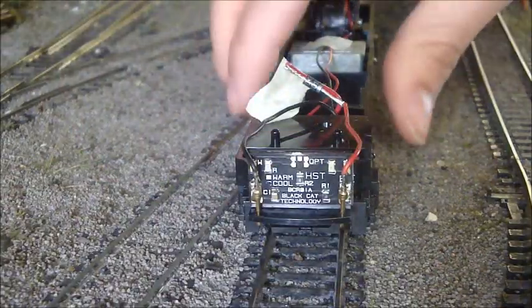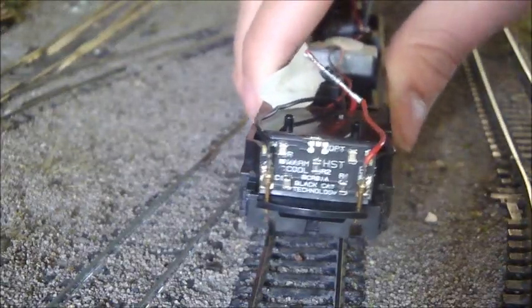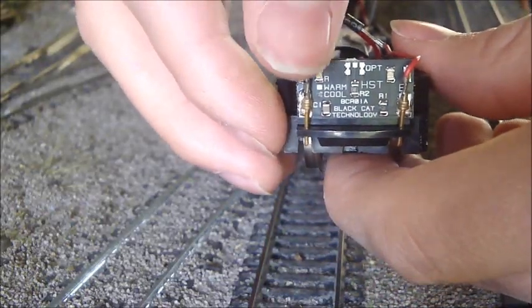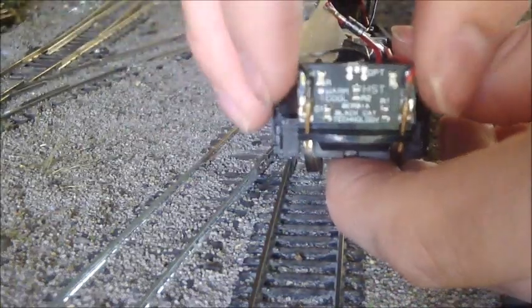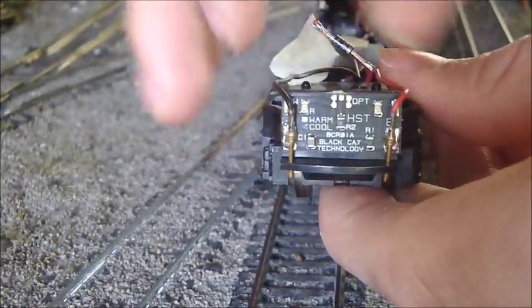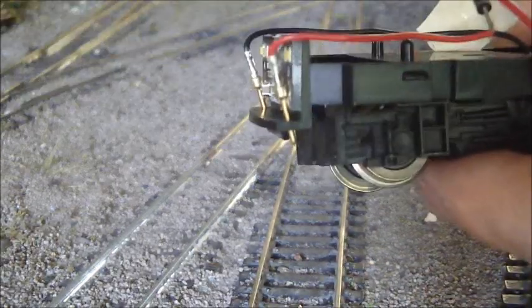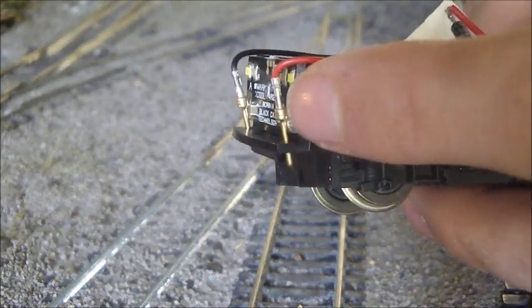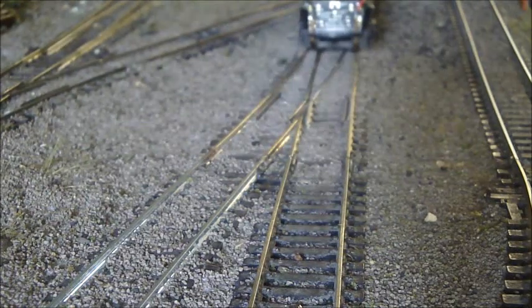That's the bulb removed. It was very difficult to hold in front of the camera. Basically, it's a fiddly job to get these wires in. If you pull the wires out, you need to slide the circuit board in — it should rest just level with the little plastic back cover. Push them down and make sure they contact with the edge of those little bits at the bottom of the circuit board, just where the wider part of the wire is.